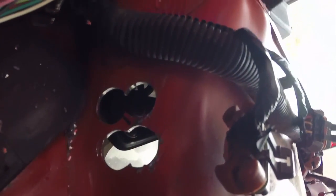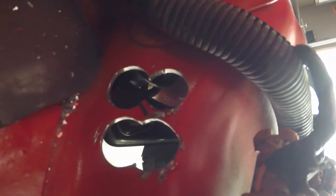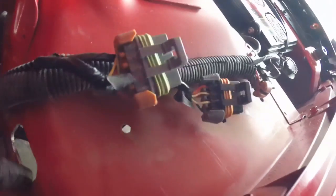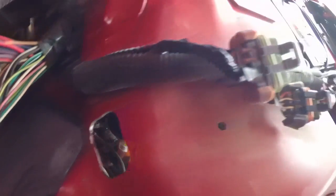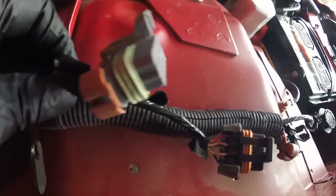I drilled four holes with the step drill bit and I'm going to take my Dremel and just make this a nice square — knock out all the pieces in the middle and make it a square so the plugs will go through. Now that the hole is cut and smoothed out, I went ahead and vacuumed all the extra metal shavings out. This could eventually cut through some of these wires even though they're in loom, so it's always a good idea to put something around it. It's a little too big for a grommet and it's not an exact circle, so I'm going to use some trim that goes on the edge of doors — you've probably seen it. I'm going to use it in black, just put a piece all the way around there to keep it from chafing and cutting into the wire.